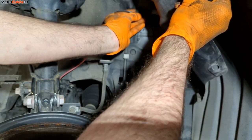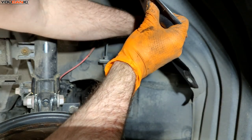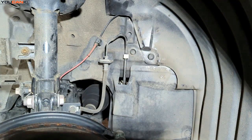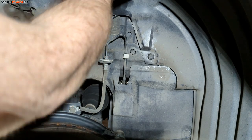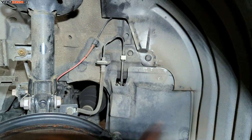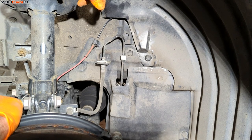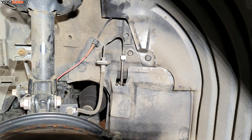Push the clip in, then reach in and reconnect the electrical connector — press and hook the clips. Put the push pins back in the wheel liner. The next step is to use your scan tool: key on in the accessory position but engine not started, then clear out the codes caused by the faulty ABS wheel speed sensor. That's how you replace it on your 2021 Mazda CX-9. Thanks for watching Ucanic — you can be the mechanic.